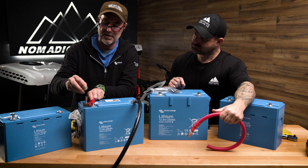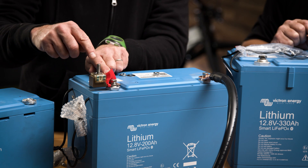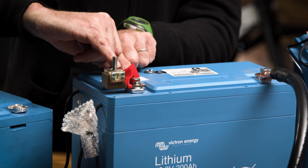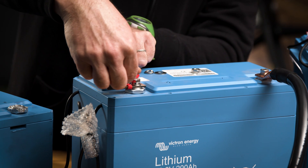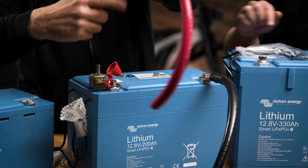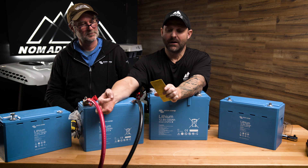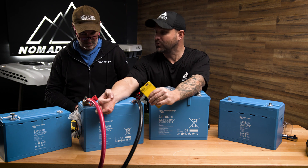Have it the right way up where you can read it — it fits in there very nicely. When we put the cable on, it comes down onto this surface area. When that fuse blows, it breaks the electricity going through and it won't be able to reach the terminal. On the back of the packaging it gives you all the information for this MRBF terminal fuse block. We're going to be at 75 inch pounds maximum torque, or 8.47 newton meters.